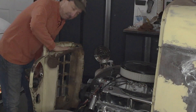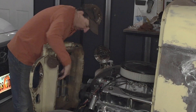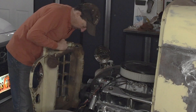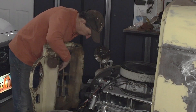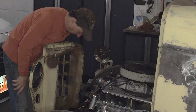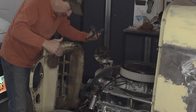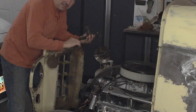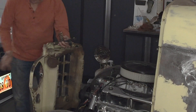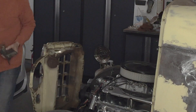I'll use as much of this top panel as possible, cut these off, and then the same thing down here at the bottom - it was cut and bent up, so I'll have to bend that out. It looks like they actually welded it on both ends too, so I'll have to cut that weld. Now that I have this in place and see what I need to work with, I'm going to keep it mounted to the chassis while I work on it, but turn it around so I can work on it from this side - gives me good balance and good access.